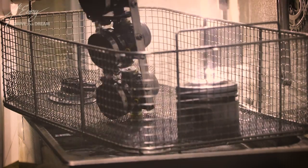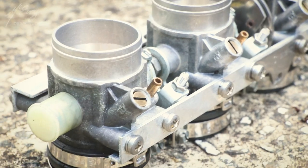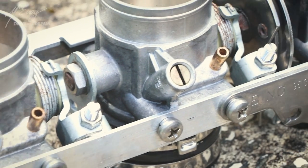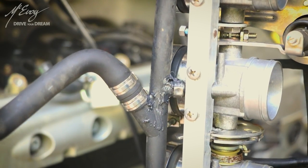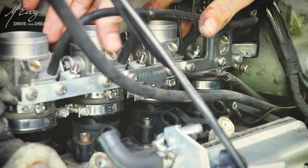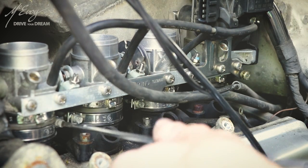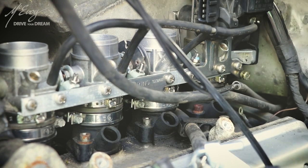Nice and steaming hot and perfectly clean — brand spanking new. Now there's that little blue balancing screw which you do not want to touch at all. I sabotaged myself but it's better than nothing; I didn't think of ordering this part when I should have, so you guys do that. If you intend to take the throttle bodies off or if your bike runs like a sack of rocks, that might be the cause. So I cleaned it out, cleaned all the balancing tubes and now it's all squeaky clean.